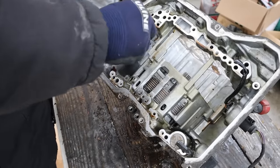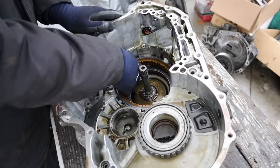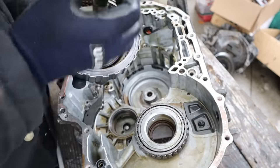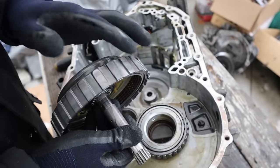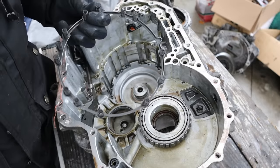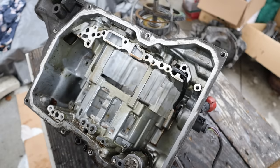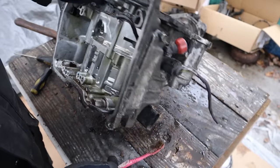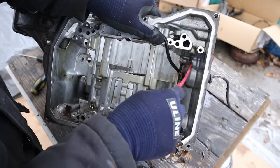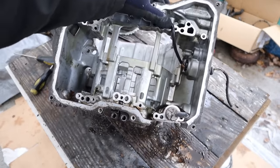Just going to remove the speed sensor. So we've got another snap ring — I like these snap rings because you don't need pliers for them. Now I can pull out this clutch set. This clutch set looks brand new. You get another clutch set again — this one also looks brand new; it does have that paste on it though. Just one more snap ring in here — that's the last snap ring, and that holds the return for a piston. Now this last little wall in here is actually a piston. The way you're supposed to get it out is by blowing compressed air through the correct hole, and it should just pop out with pressure. That's pretty much it for the guts of the transmission. If you don't have a transmission dipstick, they just put this plastic plug over here which is pressed in. But if you had a transmission dipstick, it would go underneath the valve body and into the pan so you'd be able to read your transmission fluid.